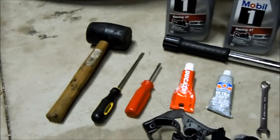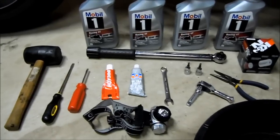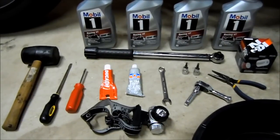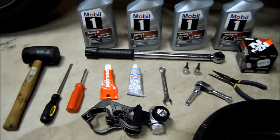Just because the sump cover is glued down with ThreeBond, it takes a bit of coaxing to get off. I used a razor blade last time, but I think tapping it would be just as easy, and you're not really going to be leaving any marks as long as you're gentle.